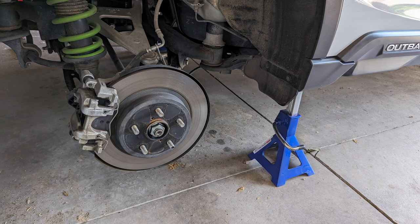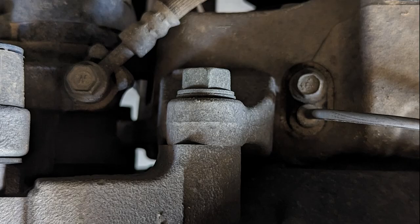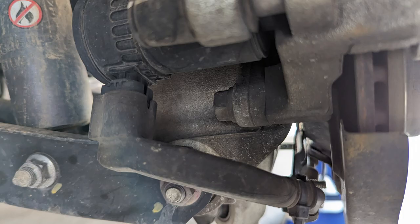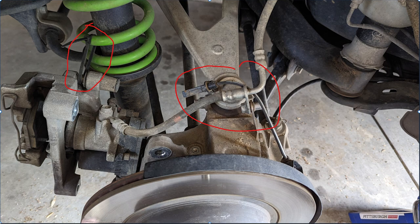This time I actually removed my tires. I did not unbolt any of the suspension, and you can see my nice recalled Harbor Freight aluminum jack stand there — I survived this one. You can start by unbolting your wheel speed sensor for the ABS, then unbolt the brake calipers. Kind of tuck everything to the side and hang things — I used a little zip tie to hold the brake calipers so they didn't put strain on the brake lines.